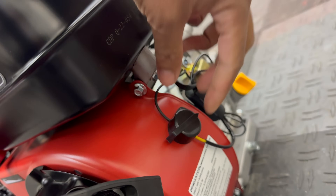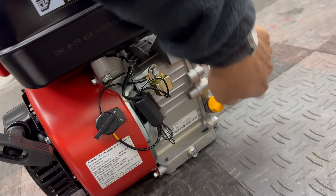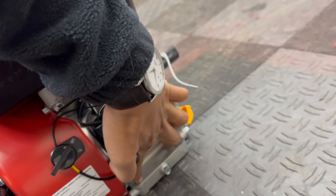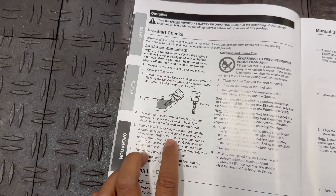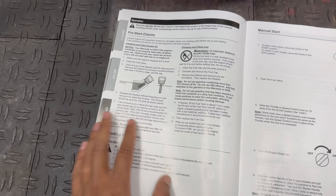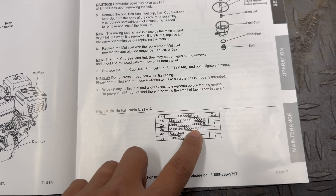There's an on/off switch — I might rewire this so we have access to it on the handlebar, but I might just run it like this for the start. This is where you fill the engine oil into the crankcase, the engine has four mounting points at the bottom, and this bolt is the oil drain plug. According to the user manual, the Predator 224 uses 10W30, so I'm going to go get some. It did come with a couple of different size jets depending on what elevation you're at, and for fuel it just uses standard 87 octane.